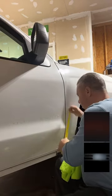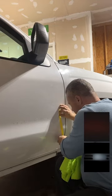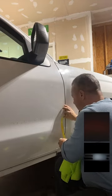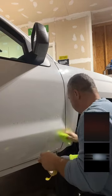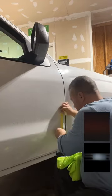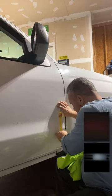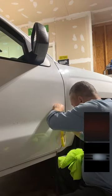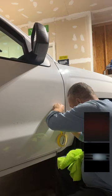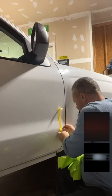Yeah, and again, you're almost forced to do it. You cannot heavy cut this. Most likely by the time those vehicles were 2013, 12, 11, 10, 9, the sun has thinned them out. They were already thin to begin with, and at some point, multiple times, somebody's already had to pull it and polish these up. So you literally have nothing left. Your only option to make this car look better is to destain it and then seal it.